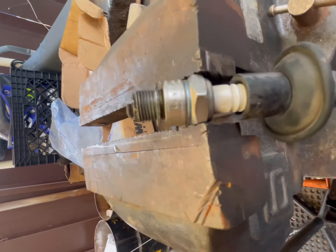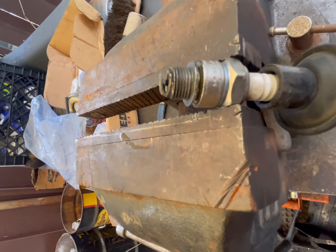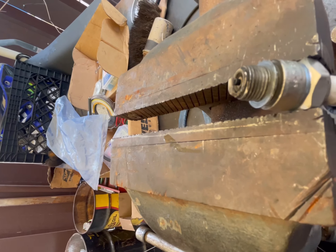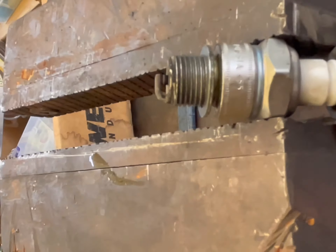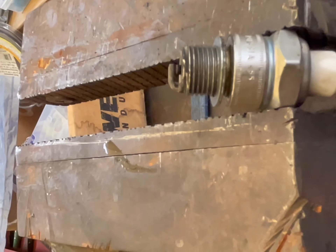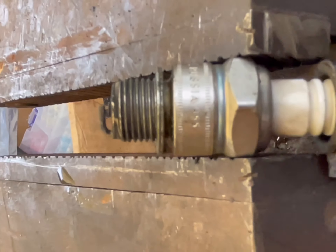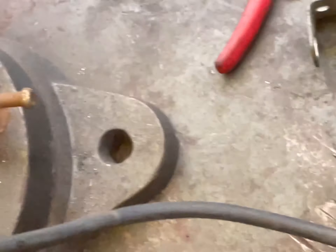We're back — I adjusted the points again; the points were off. Now watch: turn this and we should get a spark right here. You can barely see it on camera, but the spark is very weak. You can hear it clicking though — there we go.